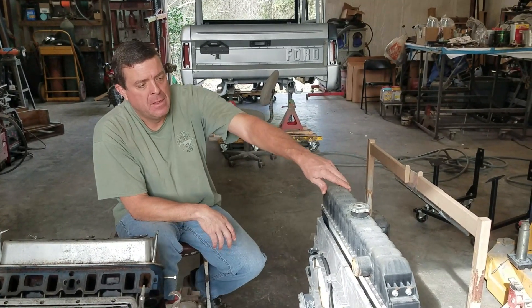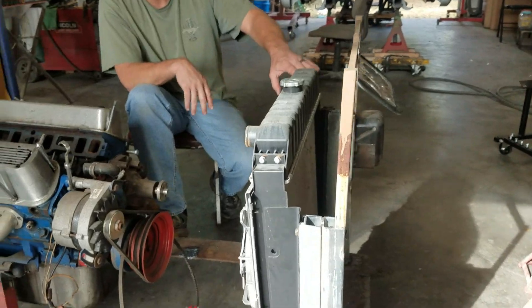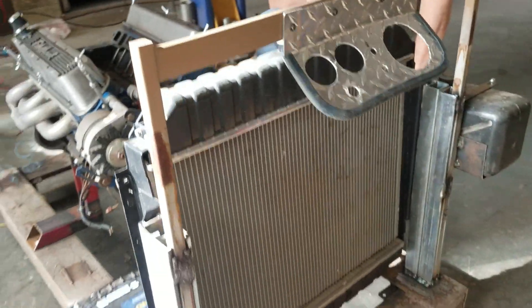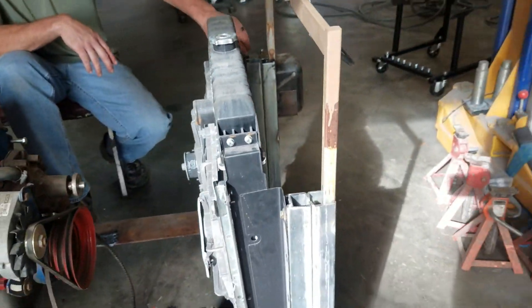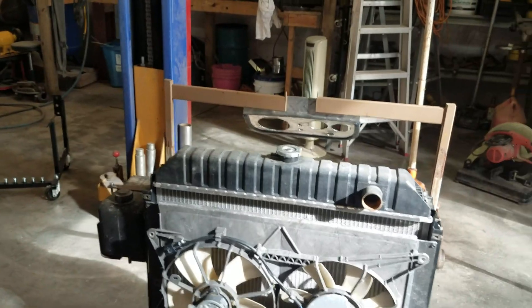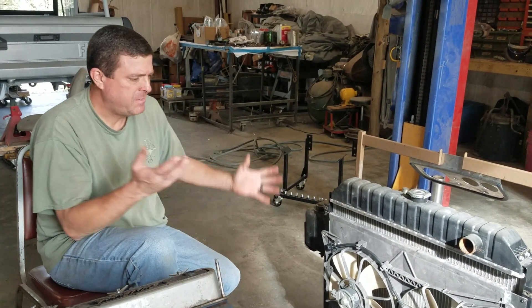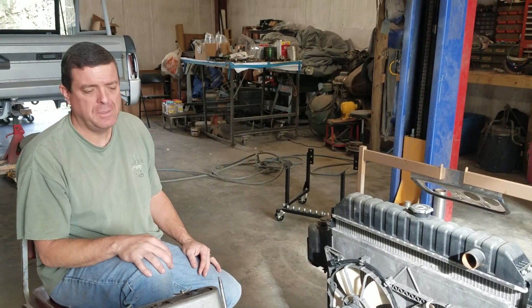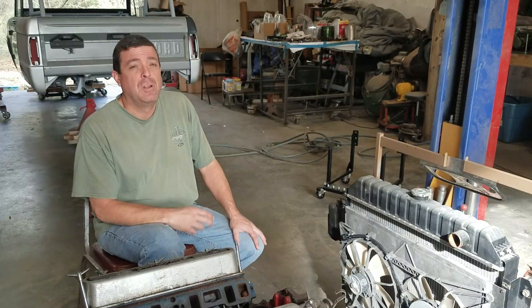The rest is just old material I had laying around. I started with the bell housing, used an extra motor mount cut on angle, and bolted it to the bell housing. The front is just some leftover tube steel and a couple pieces of channel bolted straight to the motor mounts. The radiator came with the '70 Bronco and I think it came out of a late '70s F-150 — it's in good shape and perfect for this. I'm also using a Snapper gas tank from my V10 video.